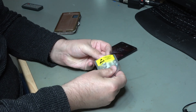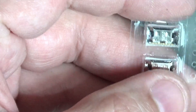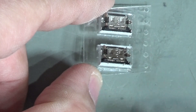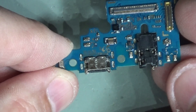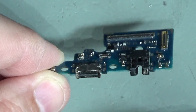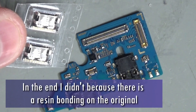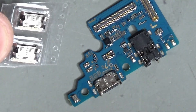On this channel I like to do component level repairs, and here are some USB connectors. These are really, really tiny — I don't know what the pin pitch is, 0.4 or 0.5 millimeters, something like that, 18 pins. So I can have a go at soldering that. These were just under four pounds for two, and this — which is an entire board — can be bought for around about the same price. So this time I'm going to do the module repair, just plug in a replacement module. What I'll attempt then is to solder the connectors onto the old board and see if I can get that one refurbished, because my wife also has the same phone — it'd be useful to have a spare to plug in for a quick repair as and when it needs it. That's the plan.